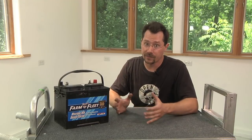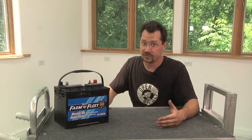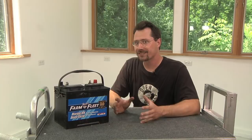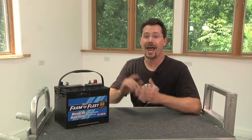We could use 6-volt batteries if the motorcycle had a larger frame. On the other hand, if we had that extra space, by using 12-volt batteries we could get double our system voltage. Now in a flooded battery, it's literally flooded — if you shake it, you can hear battery acid sloshing around in there. That's not going to be a good type of battery to have on an electric motorcycle, because at some point chances are pretty good that the motorcycle is going to tip over, whether intentionally or not. With a motorcycle tipped over, battery acid will be able to come out through the ports on the top. So I very strongly suggest not using flooded batteries in an electric motorcycle. They're great on things like electric pickup trucks.